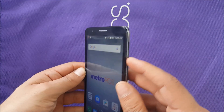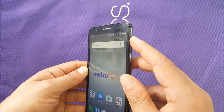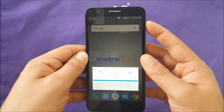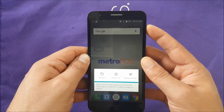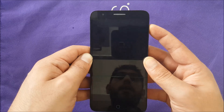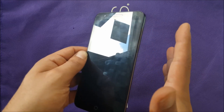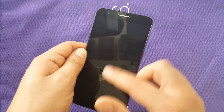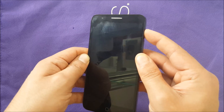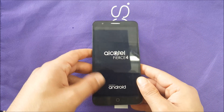You see the power button on the phone over here. Use the power button and hold it — you have to hold for 10 to 15 seconds, and after that the whole phone shuts down. So no matter if your phone is frozen or you can't navigate the screen, after that just hold the power button again and your phone will get back on.